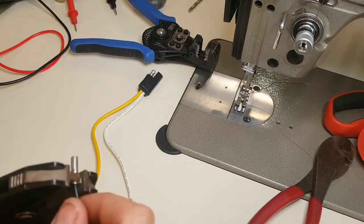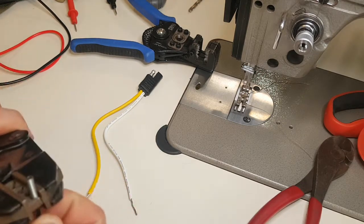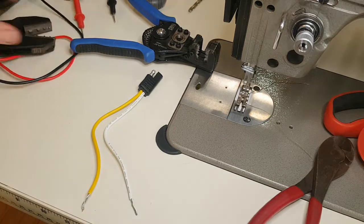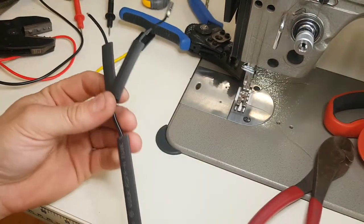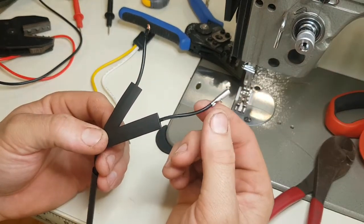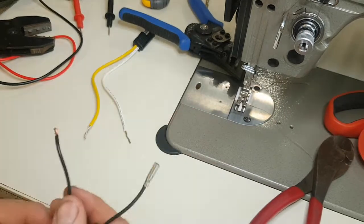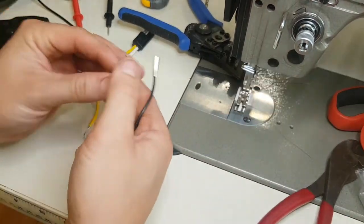This is the crimping tool — it's from Princess Auto. Use whatever crimping tool you desire. After you do this step, this should be your 'did I get everything ready?' step, because you want to have your heat shrink on before you connect to the other wires.